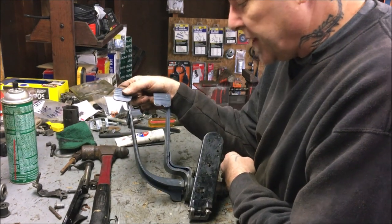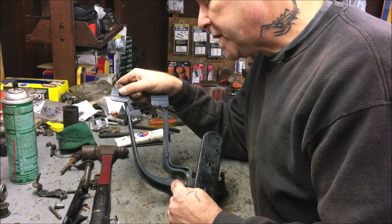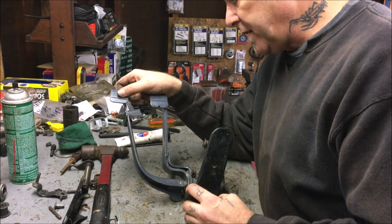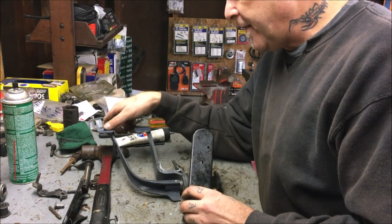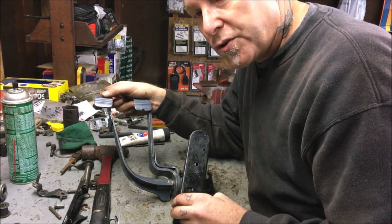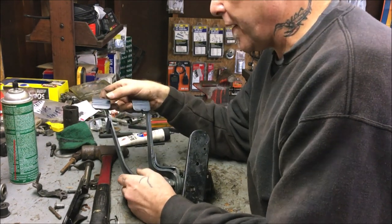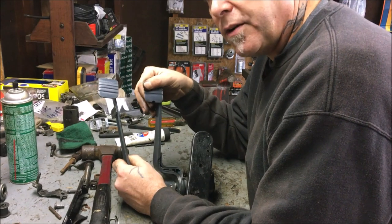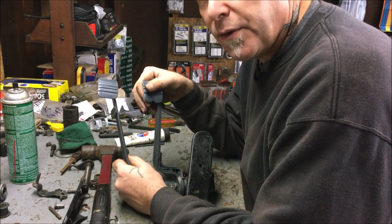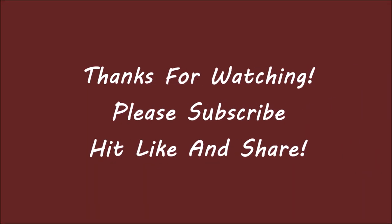You definitely want to get a new roll pin to put in there. Do yourself a favor and do maintenance on your pedal assembly, because truthfully people forget about this stuff. This stuff starts getting real stiff because it's all caked up inside with rust, corrosion, and old grease that they put in 50 years ago. Thanks for watching guys.